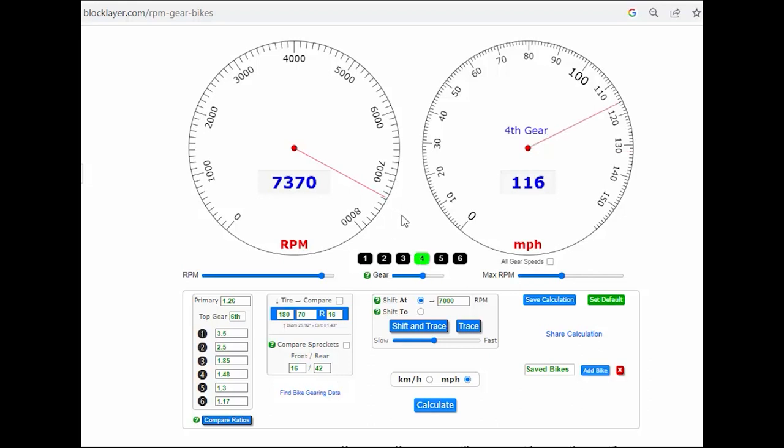And of course, very shortly I'll be getting my superchargers. So the speed I expect to hit across the line with that would probably be above 100. I know it'd be above 120 miles an hour. So let's say around 125. Be nice. I know someone who's got the stage one set up on a Thruxton and he was doing 120 across the line. So if I went into fifth, I'll be doing 6,990 across the line.